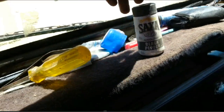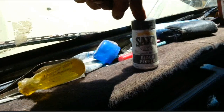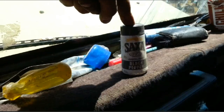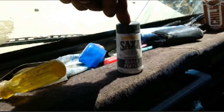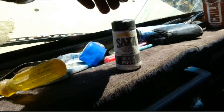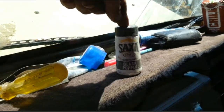So this is the stuff guys - if you ever go bush, go camping or whatever, always carry probably about two or three of these. You get a radiator leak, you might go through some spinifex or a tree twig might go through the radiator - this will block up the hole. But obviously the hole has to be pretty small. So we'll put this in, let the radiator cool down, and we'll top that with the radiator fluid.